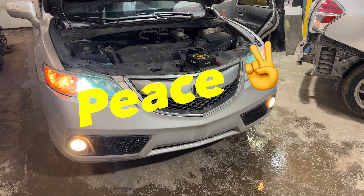This is for the RDX Acura 2015 tech package. I just want to mention something important: there's an L key so that you can turn it — it has to be straight like that. Basically, depending on your car's model and where the cutoff line is, you have to have it straight. Take it off and then turn it slightly so that it's going to be straight when you're looking at your headlight.